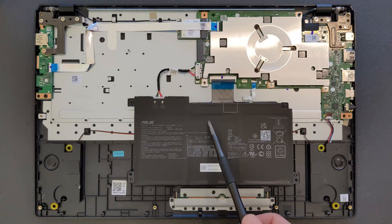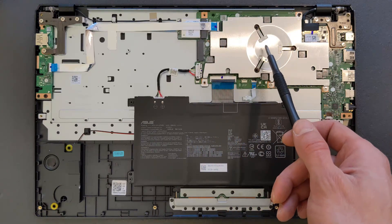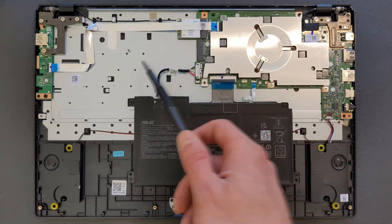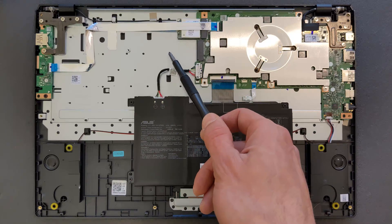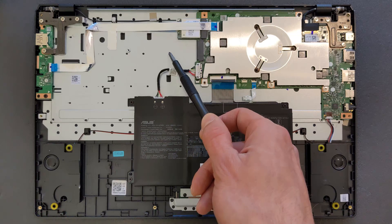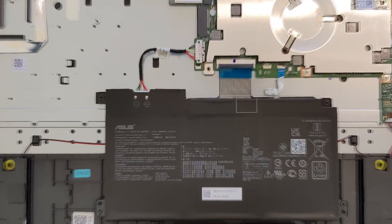I have very bad news for you: RAM is not upgradable on this laptop, only the solid state drive. You can add an extra solid state drive, which is an M.2 SSD. On this laptop the built-in SSD is 64GB, so in a minute I'm gonna add another 128GB, so in total it's gonna have almost 200GB.